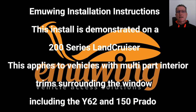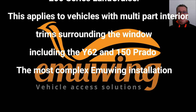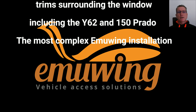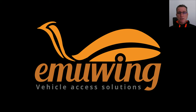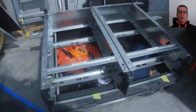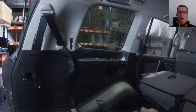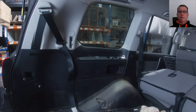The main complexity and time-consuming part of this install is the cutting of the interior trims. Multi-part interior trims just take that additional bit of work to remove, cut, and reinstall. We've completely cleared the back of this Land Cruiser — a full draw system, cargo barrier, all that's been taken out to allow us to fully remove those interior trims. We can work with the lower interior, but it is much easier if you can remove it. So we'll start by getting all those trims off.